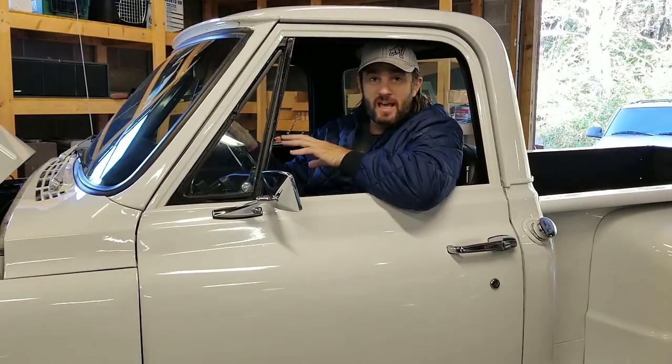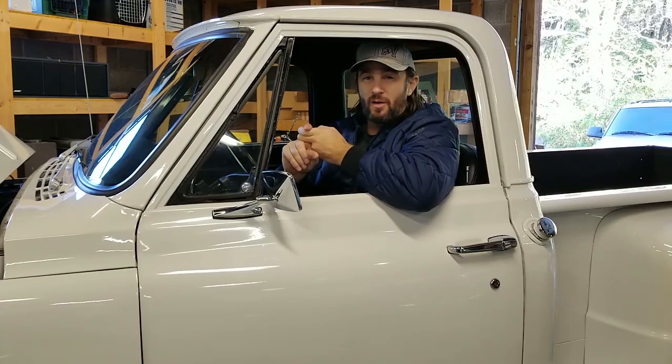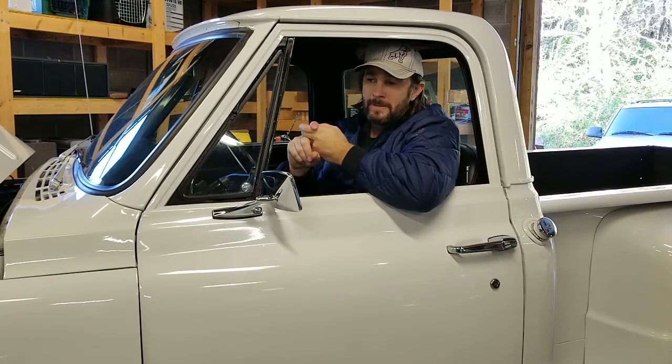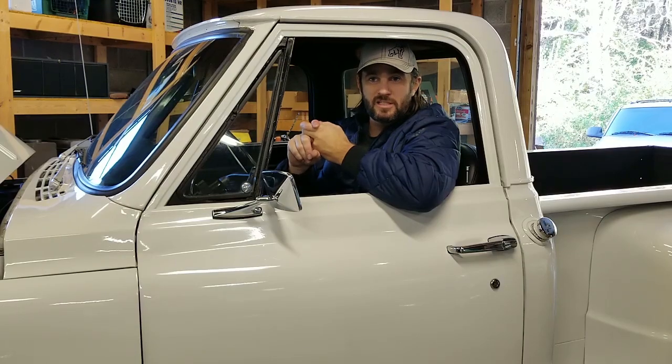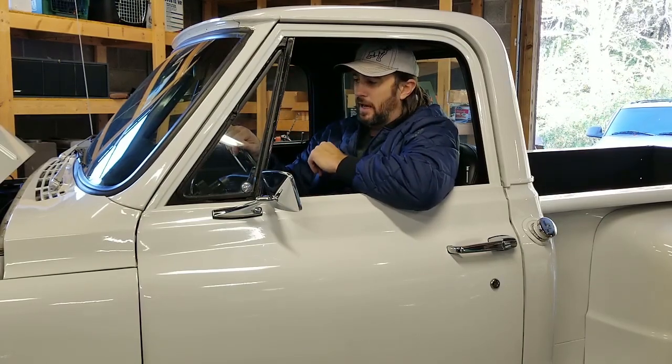The transmission's nice and sealed up. We've got a new flywheel. We've got a 3000 stall. I wanted a 2500, but I did not want to wait another 2, 3, 4, 5 days, pretty much a week by the time you have a weekend pass through there to get it back. So 3000, it's brought it down from the 4000 it was at. I didn't pick that with it.